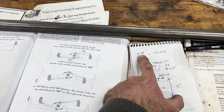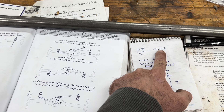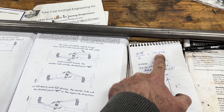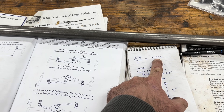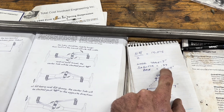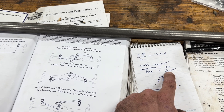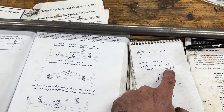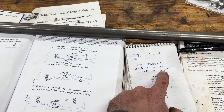My frame is 31.75 inches, so I started with 15.875 as basically center to center of those bars. Then I take half of this, and my new bar length is 16.07 inches long. So that's what I'm going with.